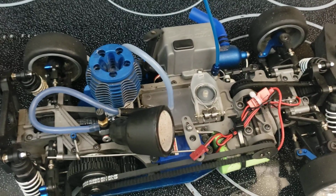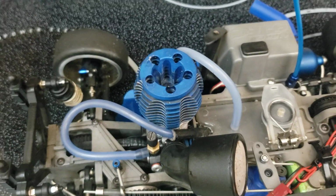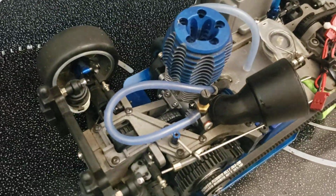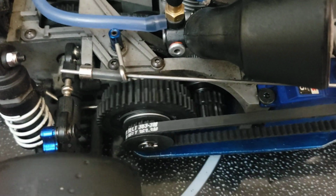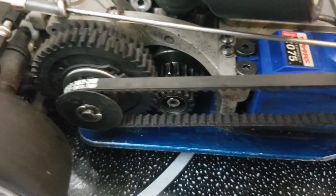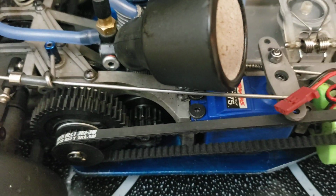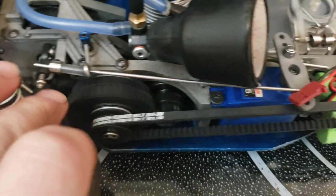So this is the Fortec. Obviously got dropped off for repairs. We repaired the engine in it, which was a new set of crankshaft bearings, new connecting rod, wrist pin, a cleanup, blah, blah, blah. And I just finished putting new transmission gears in. So the clutch bell gears are new. What a pain those things are to get off, man. They were stuck really good. So, yeah, new first and second.